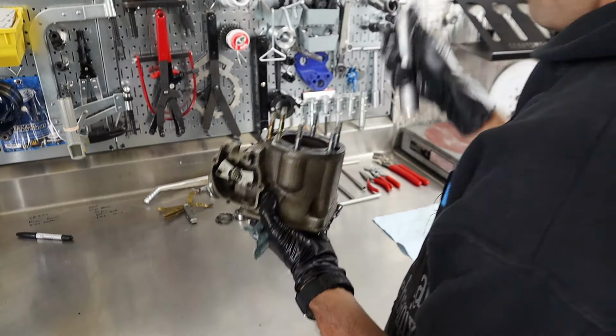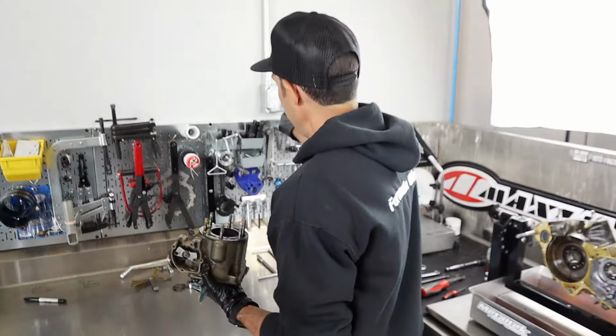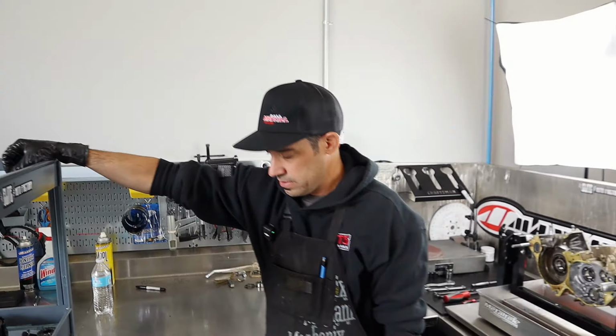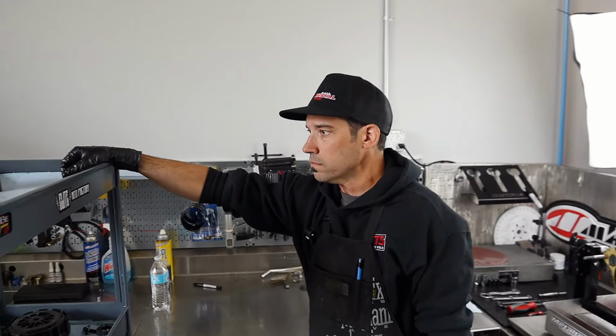I mean, it actually has a decent crosshatch considering. Okay. I mean, you were pretty sure that was the OEM crank? Yep, it is a KZ3 rod. That's an OEM 250R. Nice. We got off light, bro, so far.